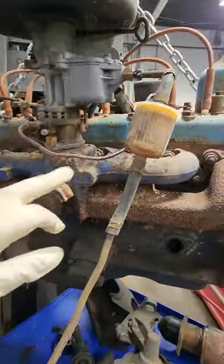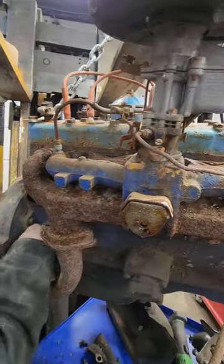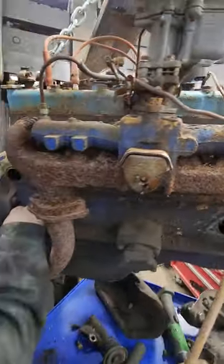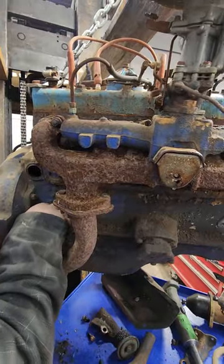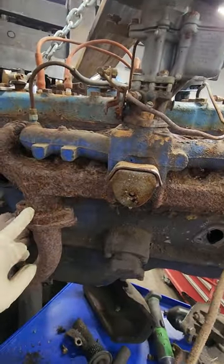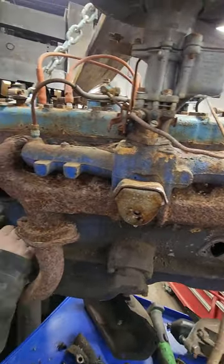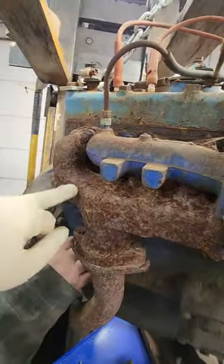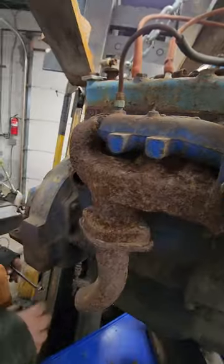So this is your intake manifold — that's where the air comes in. This is your exhaust manifold. And this is a later engine. You can see how it dumps straight. If it was a '49 and below engine, for the most part it would dump after cylinder 6 and it would come off on a curve.